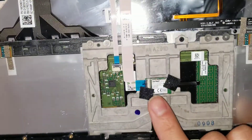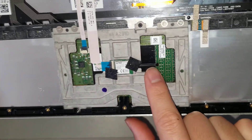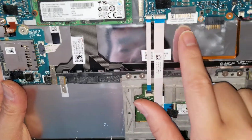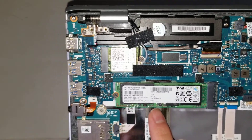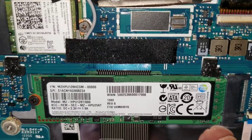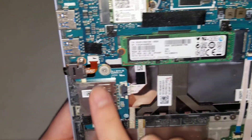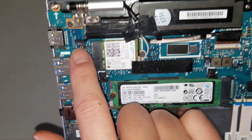There's a little chip here — it's part of the trackpad because there's a cable going out to it. You can see the trackpad connector here. This port is for if you have a dock. Then you've got the SSD, which looks like a M.2 NVMe — it doesn't have two notches, though sometimes there are SATA ones like that. You can look it up to confirm. There's also a connector here for the SD card slot and the headphone jack, which is on a separate connector by itself.